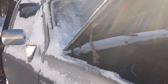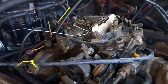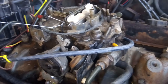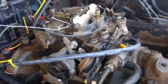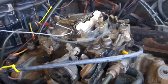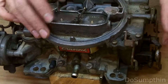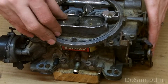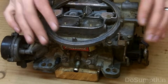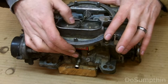Here's my old '84 Chevy K20 and I'm gonna be replacing this rigged up old Quadrajet. The secondaries are missing their linkages and it's got assorted other issues. I'm gonna be swapping in an Edelbrock 1406 - it's got an electric choke and it's a four barrel. This came off of an El Camino I used to own. I rebuilt this about ten years ago shortly before pulling it off the car. It's been stored ever since, but I think it's in pretty good shape.